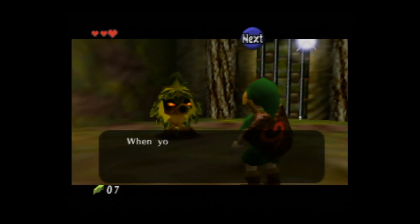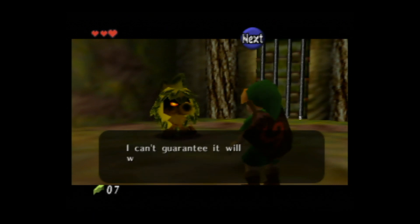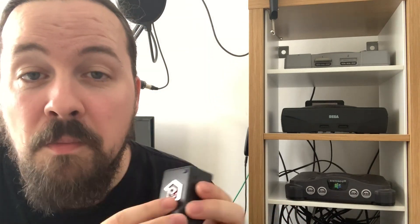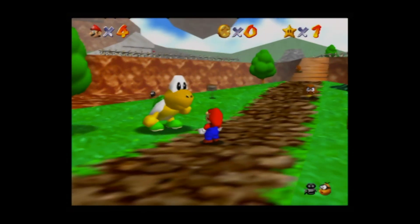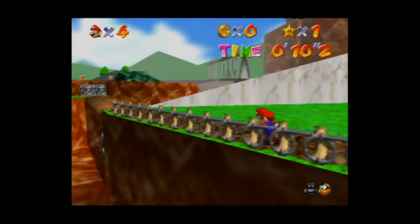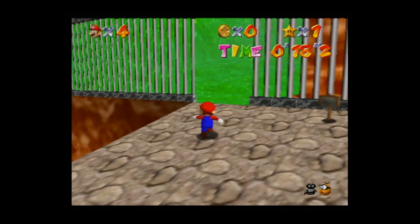Admittedly I am running a better setup. I'm using RGB SCART cables into proper upscalers, which does look better than this, but I spent more money on that than I spent on this little device. And what this does, it does very, very well. If you look carefully on the device, there is a tiny little button right here. If you press this button while your Nintendo 64 is turned on and this EON device is plugged in, it will activate the Slick mode. What Slick mode does is add its own sort of filter on top of the output of the Super 64 — it's almost like a very subtle blur filter — and it just tidies up some of the jagged pixelation from the system. What you've got is a console output that's already quite blurry, and you're adding another blur over it, which might look a bit better on larger television screens.